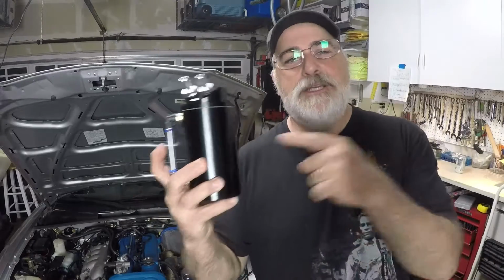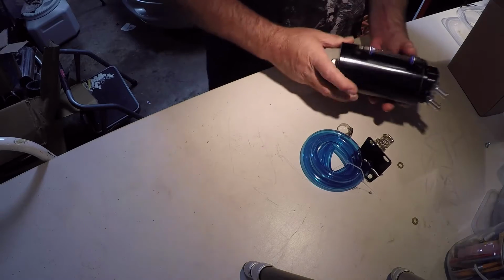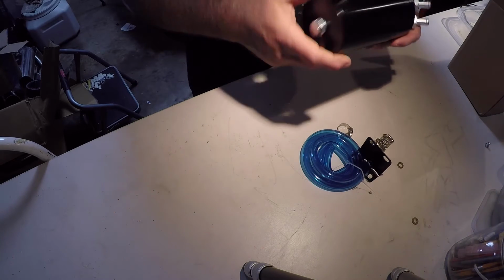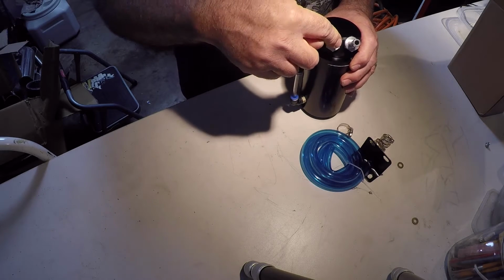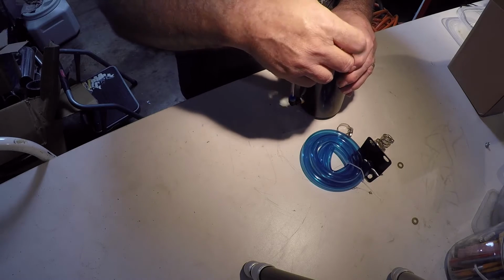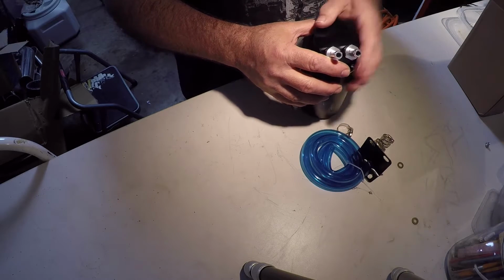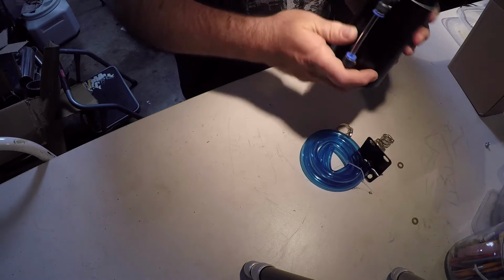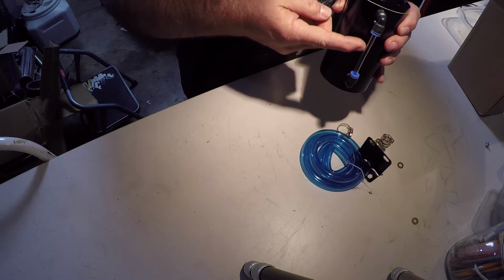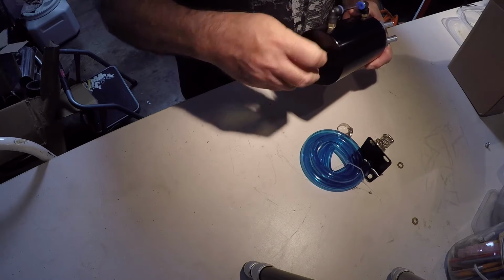And this is it here. This is a cheap old catch can I bought off of Amazon, and we're going to install it on the Miata. So let's do this. This is the catch can. It's a pretty cheap version of a catch can. It's off of Amazon. It costs $30. It's got a pretty simple design. Essentially, you connect one hose here, and you connect a breather filter, or maybe another hose here, depending on how you want to set it up. I'm going to put like a little filter on here. It fills with oil, and you've got this little line here to indicate how much oil's in there. And then you got like a little drain plug here on the bottom to drain it when it fills.